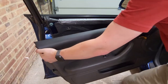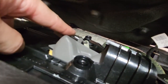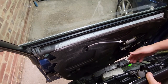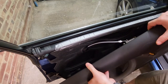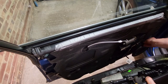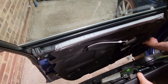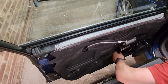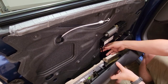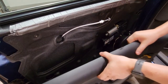With the door panel off, using long nose pliers, unhook the cable at the back for the door handle. With that disconnected, go to the electrical connections. There's an electric window switch connection and a speaker connection, but it's easier to disconnect from the car side. There are two connectors — disconnect one, then for the main connection there's a pink or purple clip; pull that towards the hinge to release the connector block and it drops out. The door panel is now free and you can access the back of the door.